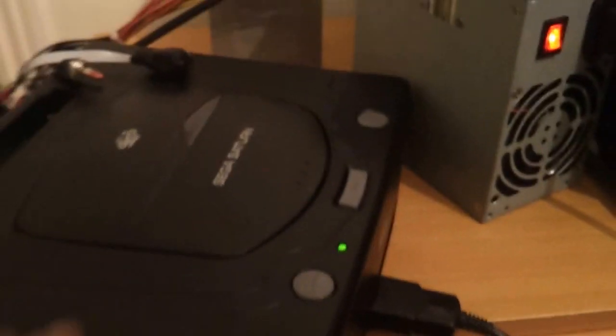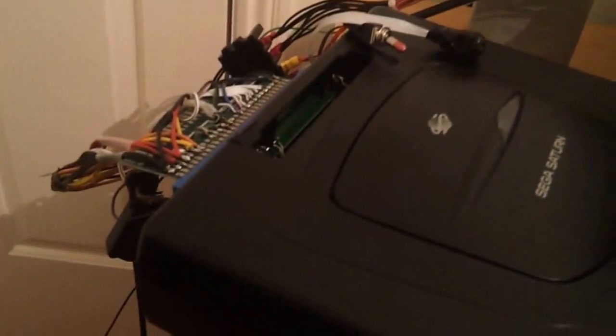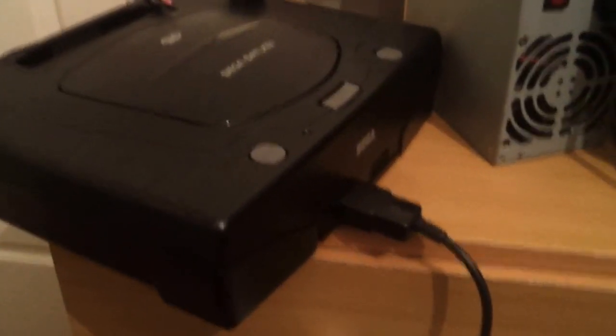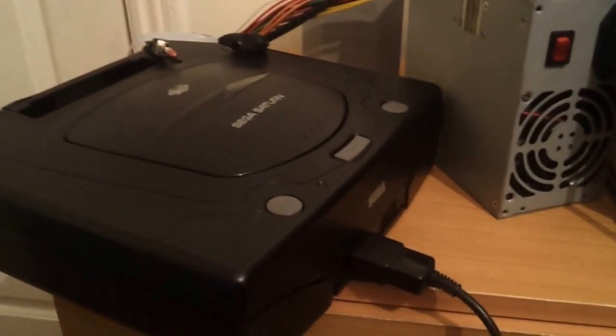Like I say, this is an early revision — just a basic setup, it doesn't do input yet. There was a slight bit of an issue with the sound, but I can't usually hear it. Video being a bit dark is an issue, but not a huge one — I'll address it when I'm done. Also, the JAMMA port is backwards: usually the power end would be on the other side, and there's a pseudo key cut in that acts as a visual guide but doesn't physically stop you from putting it on backwards. Nothing I can't address. Thanks for watching.